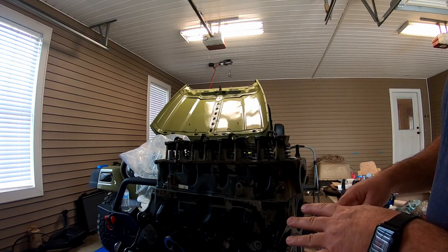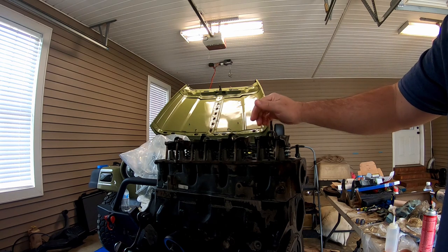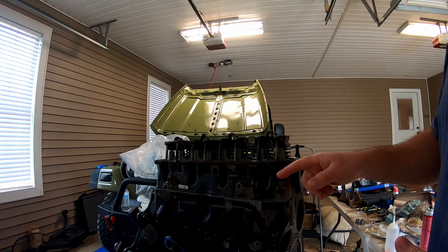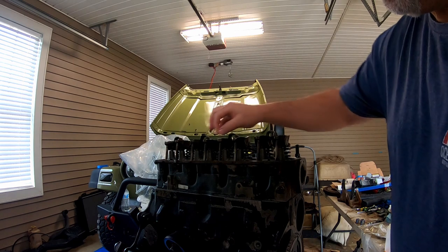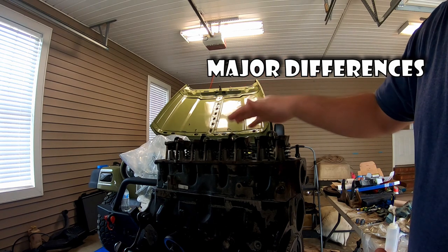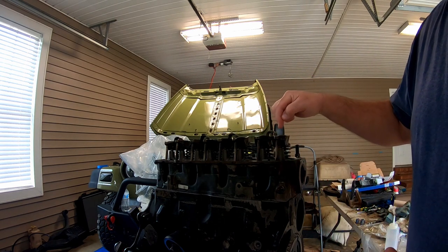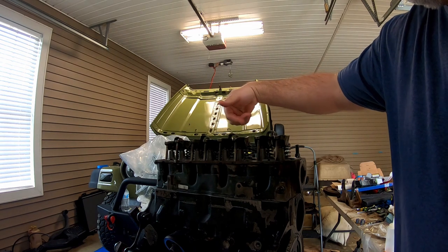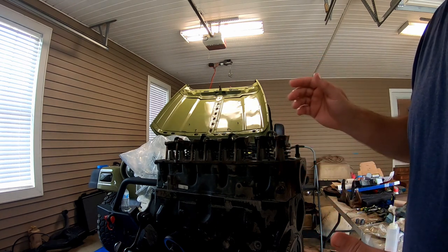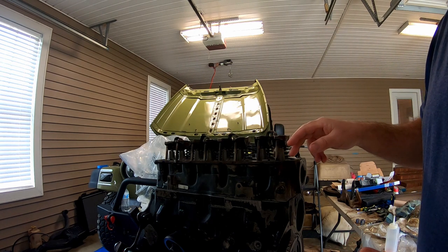This is what I've got. Cam, crank, rods, pistons, head installed. You see the rocker arms up here. These are not staying. I have new rocker arms and push rods ordered. These are not bolted down. I was trying to find out how much preload my lifters had on them, and was finding tons of inconsistencies. I had my dial indicator up there and every one was changing. Whoever the previous owners got to build this engine before, there's a potluck of rocker arms here. Many of them are different. That's why I couldn't get anything consistent. So I was going to reuse them, but there's no way on earth I can reuse these and be satisfied with this engine rebuild. So I ordered new ones and ordered new push rods.